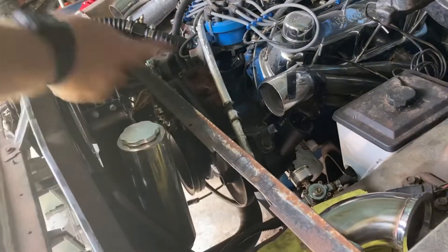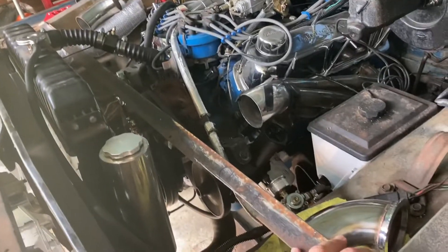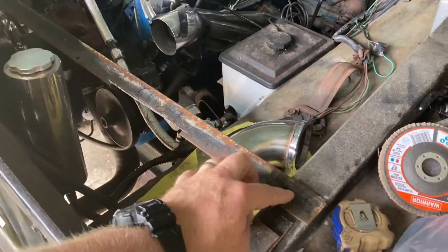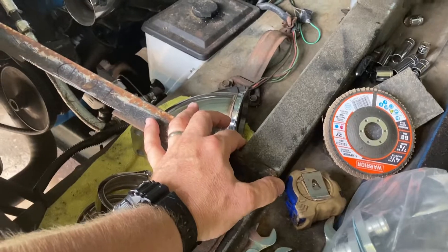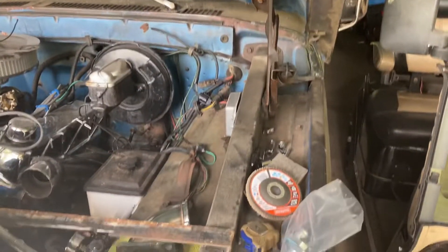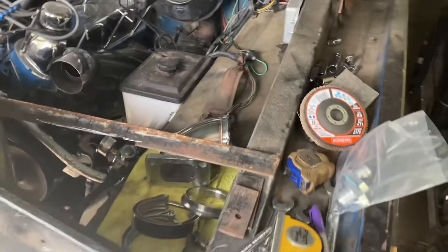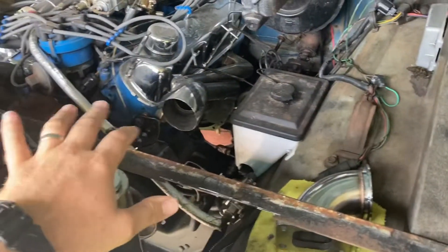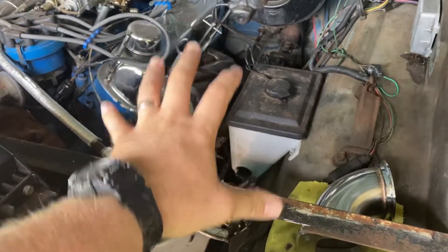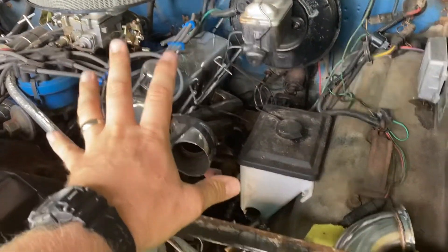Go ahead and make your measurement, cut the angle iron — mine was 64 inches. The reason you want it up to the wheel well is so when you go to shut your hood, there's clearance. You can see here's my hood, it'll go down to about right here, so there's clearance there. This is also going to allow you to get your turbo mounted so you have hood clearance, and when you shut the hood you can see and make adjustments.